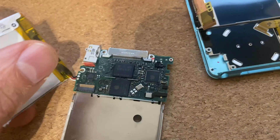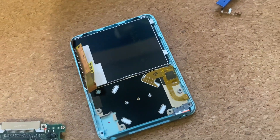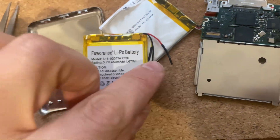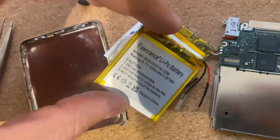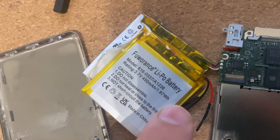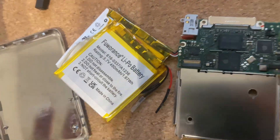What I'm going to do is unsolder it here, pull the battery off, scrape away the black stuff on the other side, get my new battery, pop it in and make sure everything is good. This is my new battery — I've got some protective ends on the end here. The cable itself isn't too much longer than the one currently on here. The one thing that is different is there is a red, a black, no white cable — there is a yellow cable. I'm going to assume that is meant to be the white cable. If not it won't work, but that is what I plan to do.